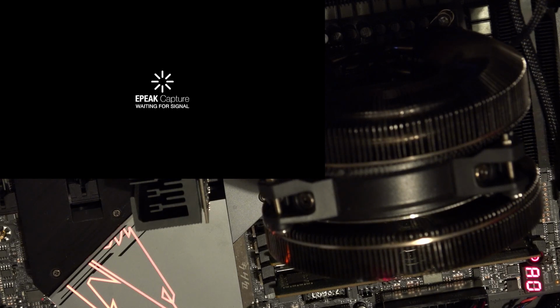Hopefully this is somewhat helpful, because you can use the same memory overclocking methodology for literally any other memory chip. If you have a memory kit and you don't know what chips it has, just go through the same process. It might seem like a dumb brute force approach, but there's really no other way to overclock memory. When I work with memory chips where I know what settings should work, it's just because I've worked with those chips a lot. There's no magic equation, because the stock spec of a memory kit doesn't tell you what it's going to overclock to at all.